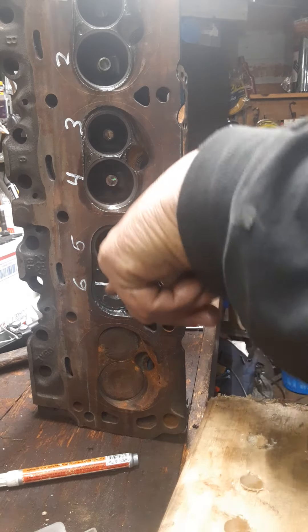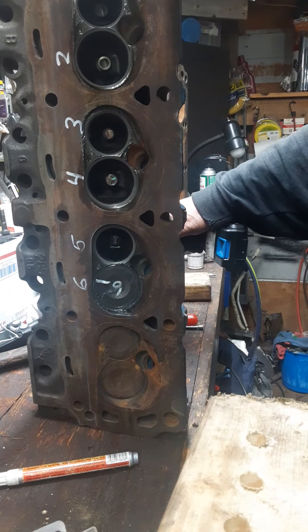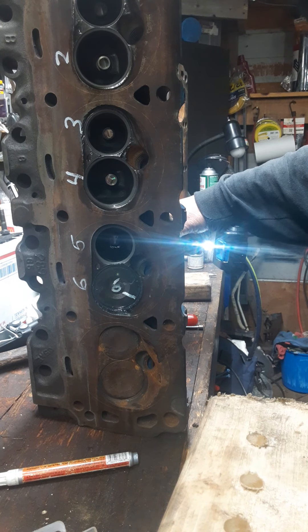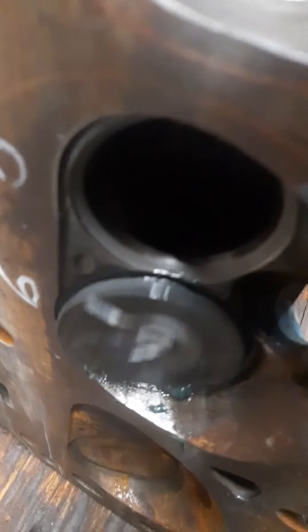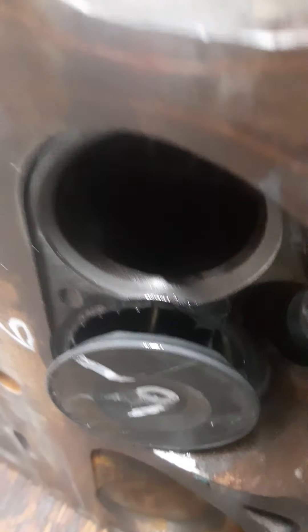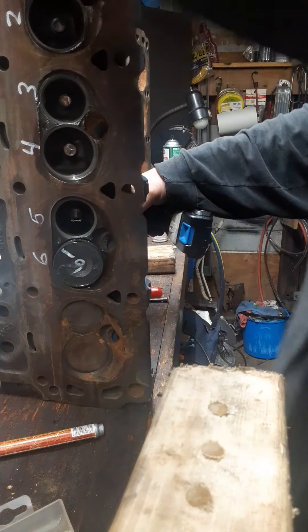What that does is it spreads out the compound back to the edge of the valve. You'll notice when you push it out you'll see a big ribbon of compound, then you pull back and do this slow. After about 30 seconds give it a fast squeeze again — I'll pick the camera up and show you. Watch as the valve comes out — see all that compound? It's all now redistributed and it's still effective, it's not all over the inside of the cylinder.